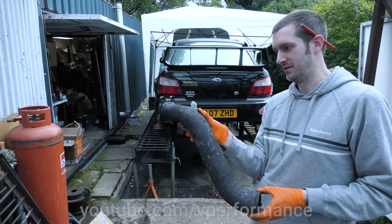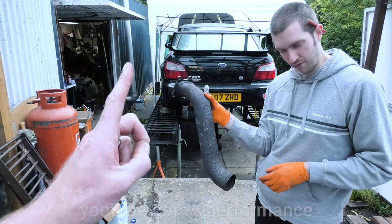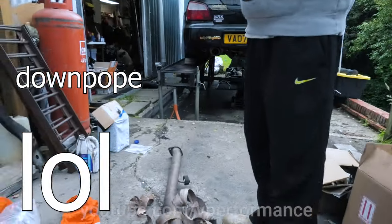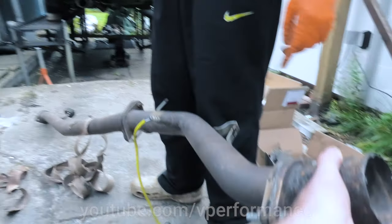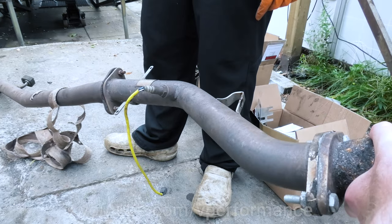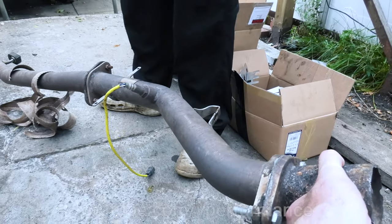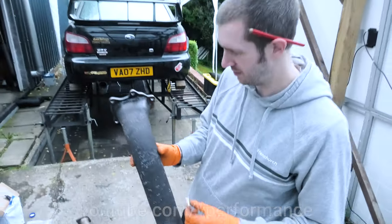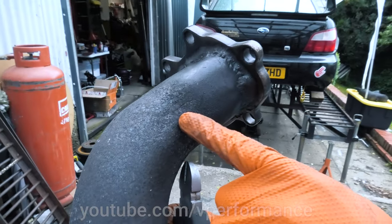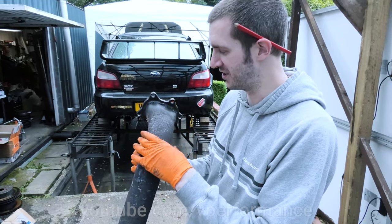And that is - I can't remember which one it is but I've got a receipt in the house, so I shall put on screen who makes this downpipe. It was a two-section downpipe - this side is a Scorpion. The bit with the yellow plug is definitely not a cat pipe made by Scorpion - that's the remainder of the stainless exhaust. That's a very narrow catalytic converter. I've just spotted a hard crack. It's cracked up there as well. We were making noises about seeing if this was salvageable, but I've decided it's not.